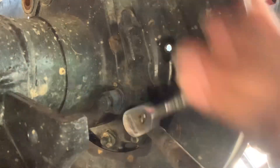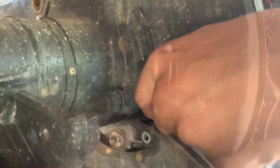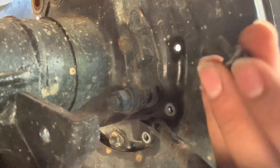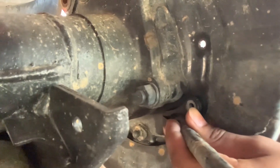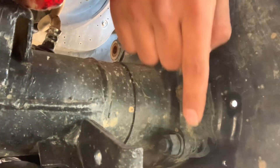We're back on day two. All we gotta do now to get this axle tube out is remove the parking brake cable and then those bolts. Now that the last two bolts are out, this cable should be able to just slide out like that. We'll set it to the side and then we're ready to start removing all of those bolts.